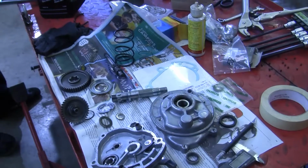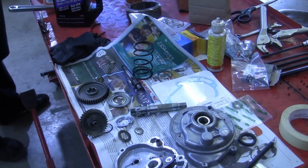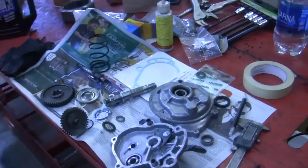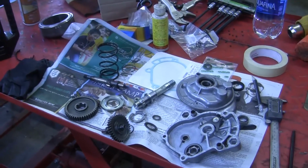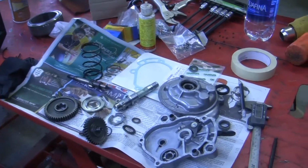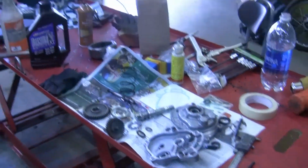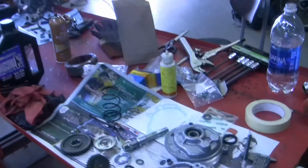That's so that in a production facility, they could just go down through with a gun and go zap, and as soon as it hits the correct amount of torque, they'd pull the gun out and move to the next one. They didn't really care about them being serviced, but they were concerned about being able to put 1,000 screws in a day. So they designed them to specifically cam out, whereas the JIS standard screws were designed to not do that. It becomes more important on the smaller diameter screws. But I digress.